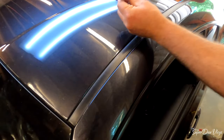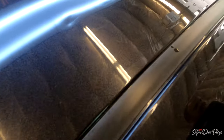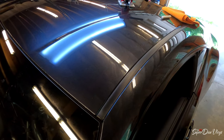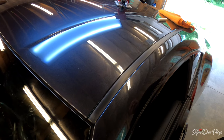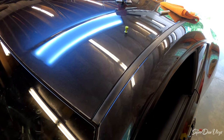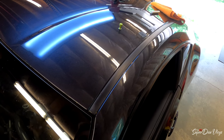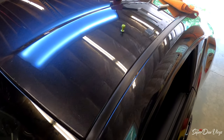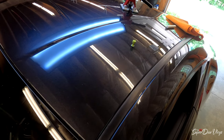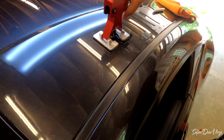These are the ones I've seen on Amazon like dent removal kits, so it's a professional setup. You don't have to pull very hard — and that probably took off one of those little dents. The alcohol on the glue makes the glue come off. That definitely pulled that up, which is okay — just like the last one, if it comes up a little high I'm not concerned. Knock that back down, blend it away, and then we'll just keep going. The other ones will be done the same way. I might push that one up — there's plenty of access underneath.